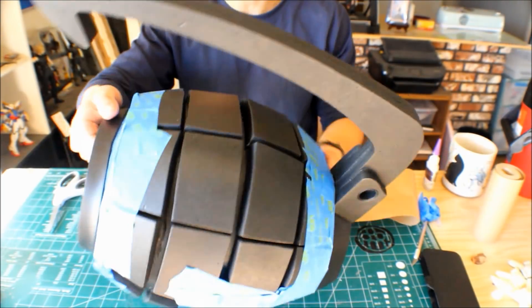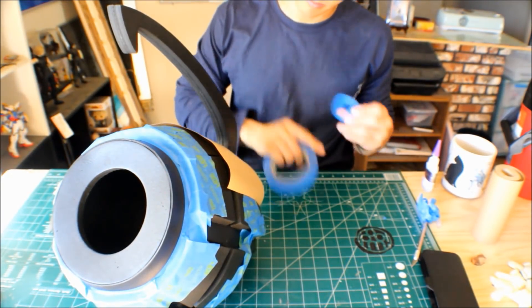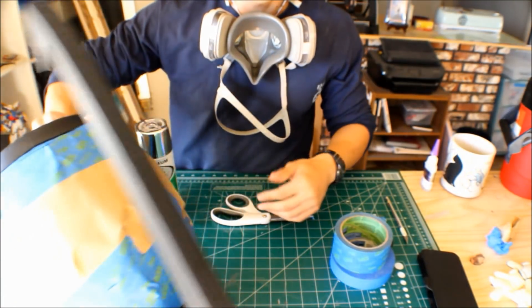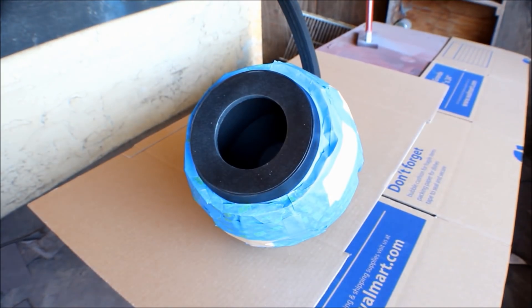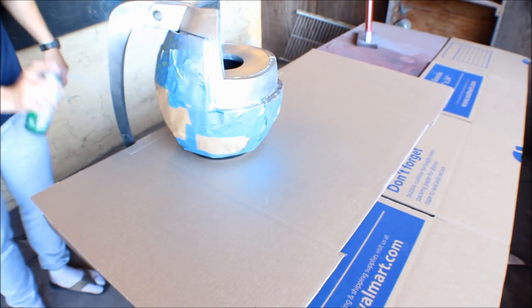Just be careful not to cut your fingers. So once we have the top and the bottom trim masked off, you're ready for masking paper. Now that I have the shells completely masked off, I'm ready to hit this with some Rust-Oleum Metallic Silver. This metallic silver takes about 24 hours to dry and in my opinion is really good. So now that we're ready to paint, I'm going to take this outside, have my respirator on, and then hit it with some silver.